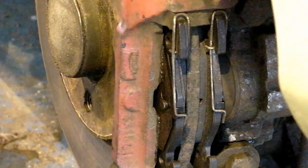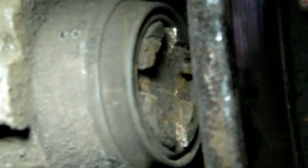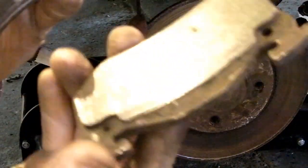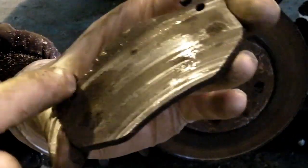Thanks for watching, hope that's been useful guys and we'll see you in the next video. Hopefully you can see the new pad — it's basically a disc with a cross cut into the sides. For comparison, here are the old pads: the outer had a little bit of meat left on it, very dusty, as you'd expect. The inner pad you can see where it's been bearing on the piston — there's absolutely nothing left at all, right down to the metal and starting to scrape. So I caught that one just in time, fortunately.